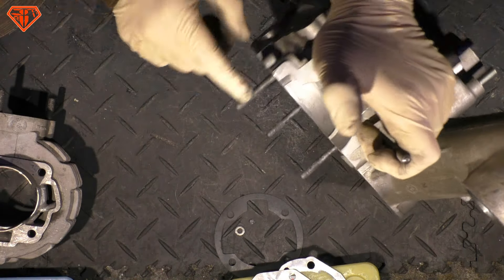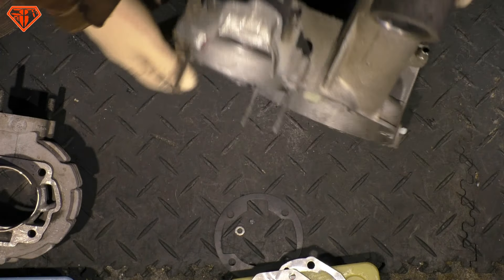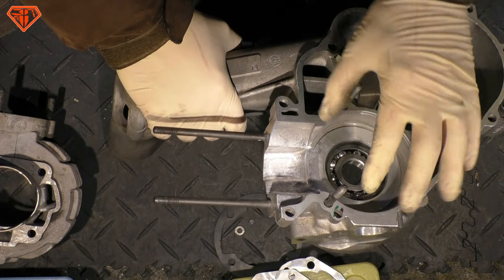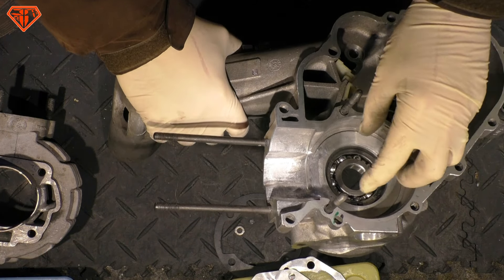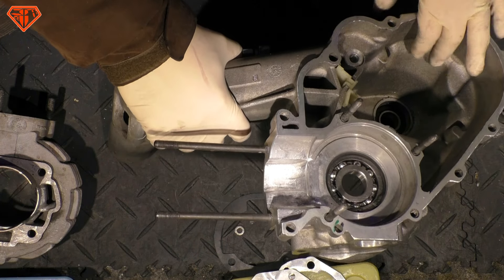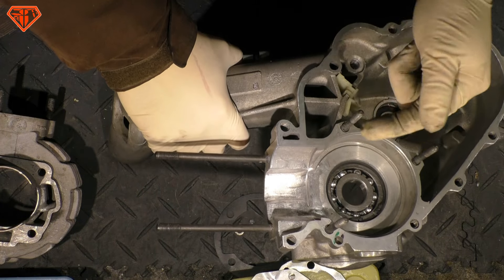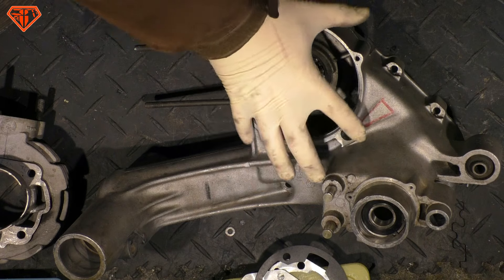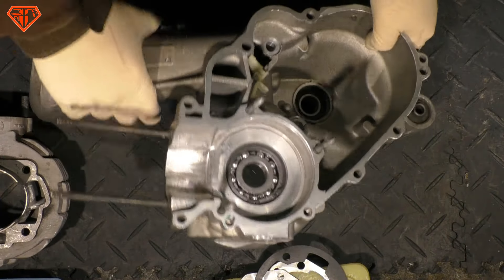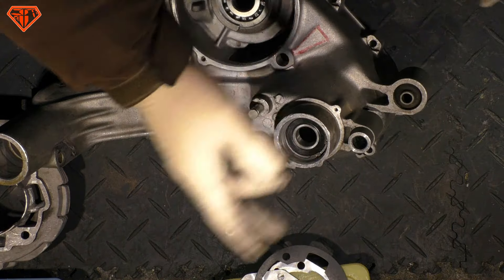You also have to take care of the intake timings — they have to be long for good power. The crankcase bolts, the engine case, the crankcase where the crank sits — these are also longer on T5, and the intake carb casing fits better. Humongous transfer ports, bigger swing arm from the 200cc compared to 125cc. Another difference: the smaller engine half on the stator side bearing is not the small needle bearing — it has the bigger rollers like the rally engines. The clutch and seven-spring gearbox are PX-compatible, though slightly shorter. The primary and rear brake are exactly the same.